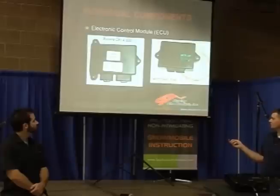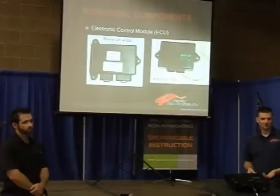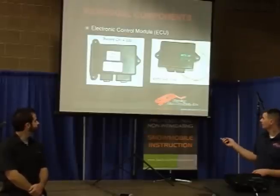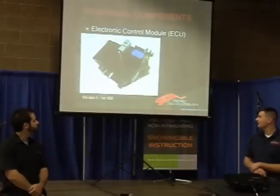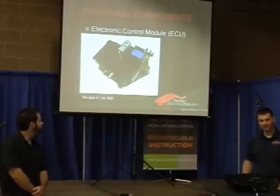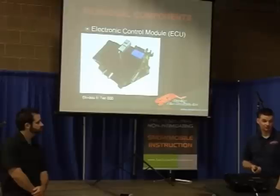The next is the electronic control module — some people call it an electronic control unit, ECM or ECU. What that is is the computer or the brains of the system. It's what gives all the commands on what all the functions of the system should be doing, but it's also what's receiving all the information from the sensors, calculating it, and then giving the command. One really neat thing about these ECUs is the Skidoo ECU — the Bombardier on the new ETEC — has fuel going into it to cool it. You'll see this input right here that's for a fuel line, and there's another one on the back side that lets the fuel come out. They run the fuel from the fuel tank, from the pump, through the ECU, and then to the injectors. So they're cooling the ECU with fuel, which is a pretty neat deal.